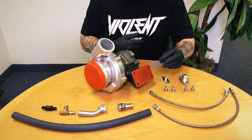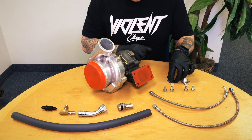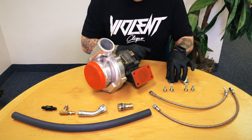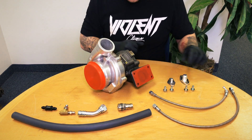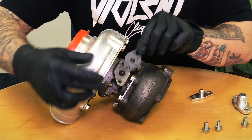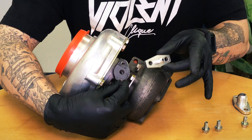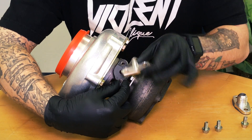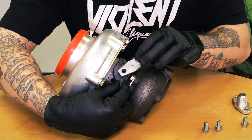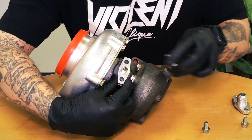It comes with the appropriate gaskets and bolts. We're going to go ahead and show you what it looks like with this part installed. First we're going to grab the gasket and hold it the best you can with the adapter plate — remember it has that restrictor built in already. Our bolts are going to go in, just finger snug.